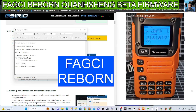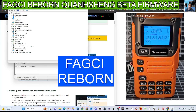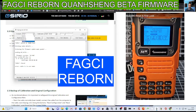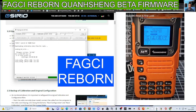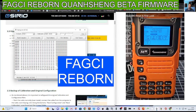I've plugged it in and selected the COM port. To find your COM port, right-click, go to Device Manager, find the cable, double-click, and there's your COM 11. Select COM 11 and I can now read the configuration — it saves a file. Let's call it number seven. I've done this many times. Save, and remember where you put that. I can also read the calibration — it actually says the word 'calibration' — number seven, save.